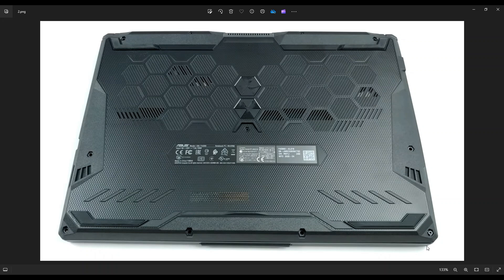You would then use a small flat, preferably plastic pry tool. I say plastic because metal pry tools tend to scratch your case a little bit. Start over here and go around the edge of your bottom case — nice and slow but firm. Don't put your pry tool too far in; you could damage some things. Just keep it right on the edge.